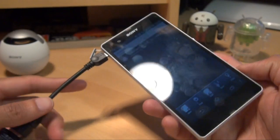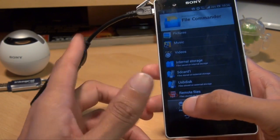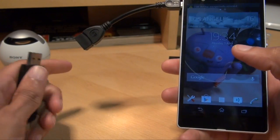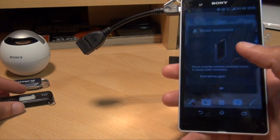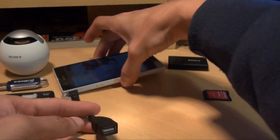There we go — that plays really well. Audio is in sync with the video, no lag at all. But as I say, the USB storage connected via the USB on-the-go cable needs to be formatted in FAT32. Anything other than that will not work. I'm just unplugging these, but in reality you should be unmounting them from the menu.